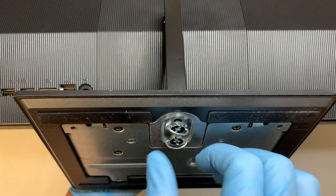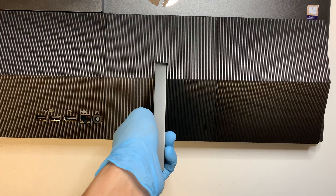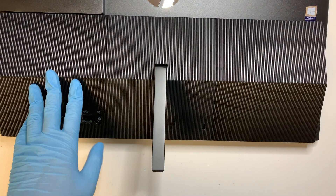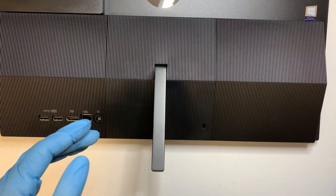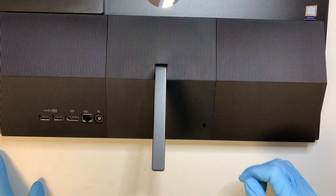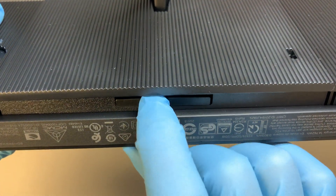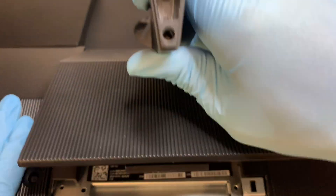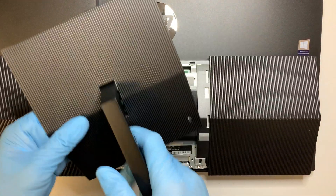For those of you who want to upgrade the RAM, this is your chance. I believe it comes with 4GB or 8GB RAM, but if you want to upgrade to higher RAM just follow this video. At this point, you'll see a small clipper — push the clipper and at the same time push and pry the stand.